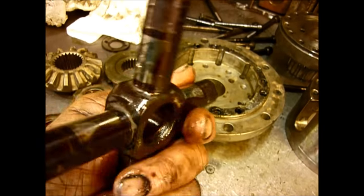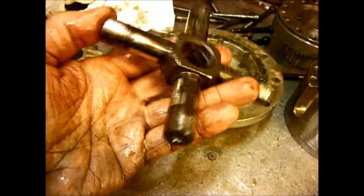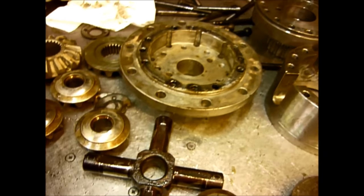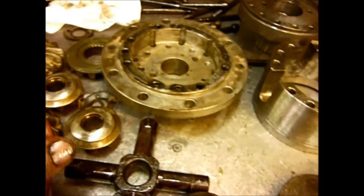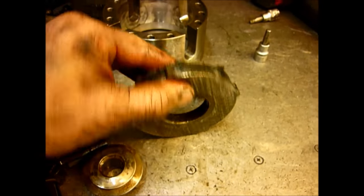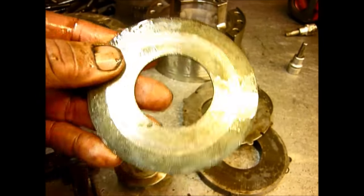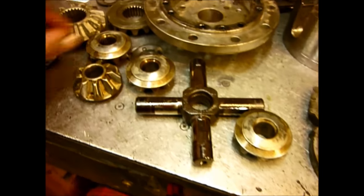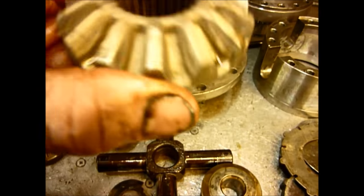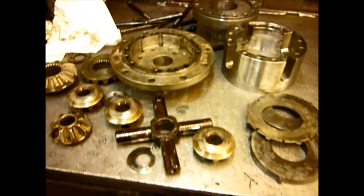It is a nice bit of kit and much better than the double cutout style that Land Rover use. These are also used on the later V8 four-pin diffs. This is an 18mm pin centre, so slightly smaller than some of the 20mm pin lockers, with standard Land Rover gears. The plates here are false plates just for packing the gap where the LSD pack would go, same with the washers. They all look in reasonably good condition, and despite the broken shim material getting mashed up inside, there is very little wear on the gear. We'll clean it all up and start looking at putting it back together — all in all, it will live again.